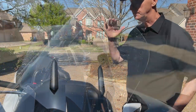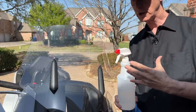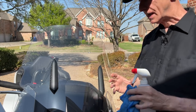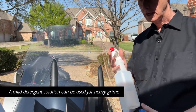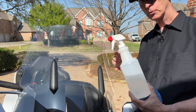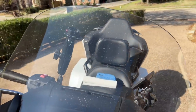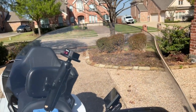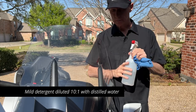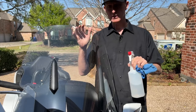What I'm going to use today to clean this windshield is just basically clean water — I'm actually using distilled water. I don't think you have to use distilled water; if you have filtered water, that's better, but you just want to make sure it's good clean water. The best thing about this is it's available anywhere. Even if you're at a gas station, I always carry a small pistol grip sprayer with me when I travel on a road trip, filled with water — you can fill it up in a gas station bathroom if necessary. I have never had a windshield so dirty that it couldn't be cleaned with just water. If you ended up with tar or something really sticky like tree sap, then you might have to use a mild detergent, but that's a pretty extreme case. Even bugs that splatter on the windshield or mud will usually come off with just water.